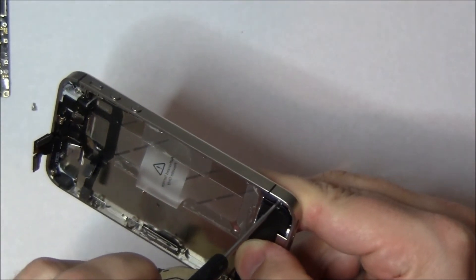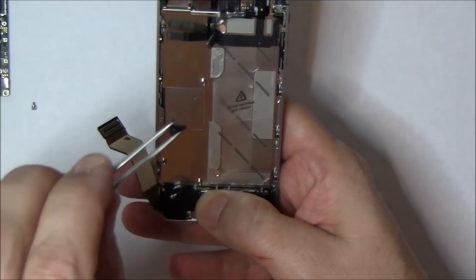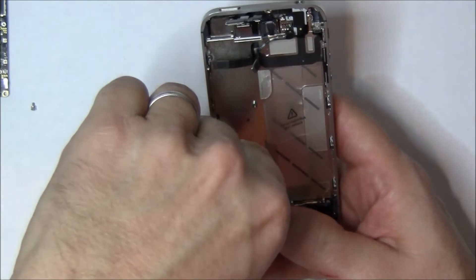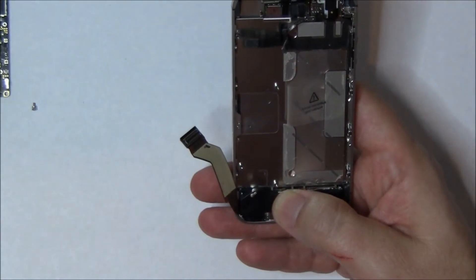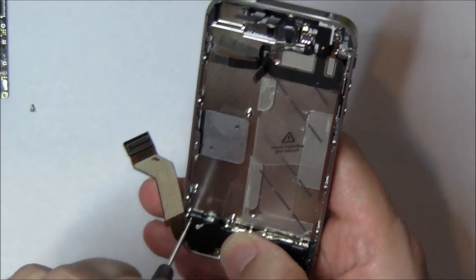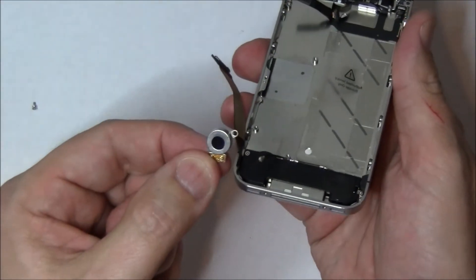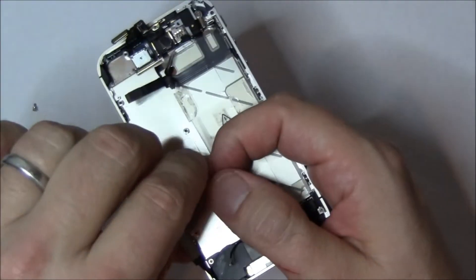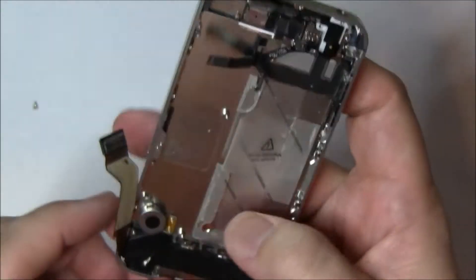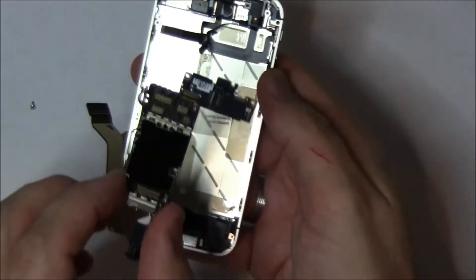The screw on the left has a little plastic triangle spacer that has to sit on top — it only sits in one way — and then you screw it in. Now comes the vibration motor that we pried out. Apple actually put on their motherboard a defining etched line to show you exactly where it goes. You get the contacts inside that little box, the top screw piece mounts over its hole, and once it's in, you screw it down as part of the motherboard. Now the motherboard goes in — make sure you fold back all the flex cables. It slots in from the top and then lays down.